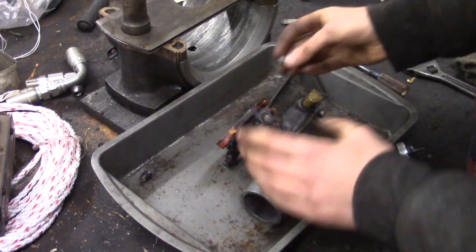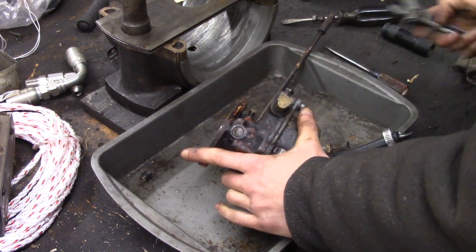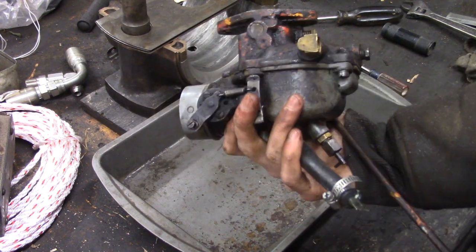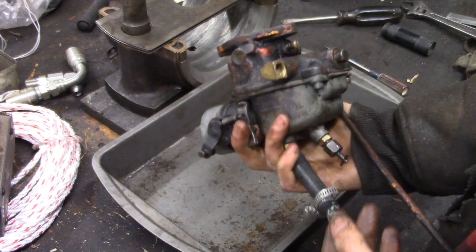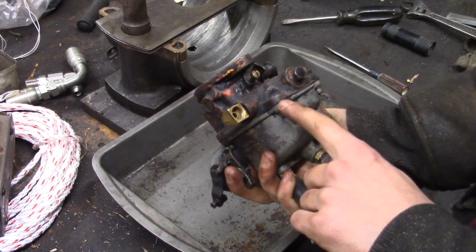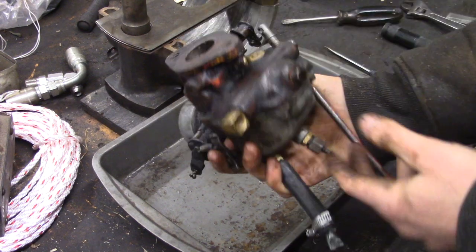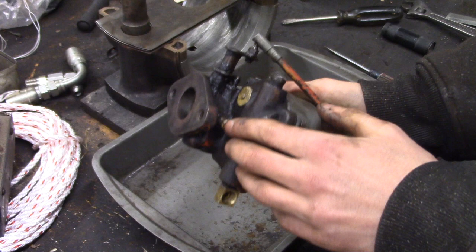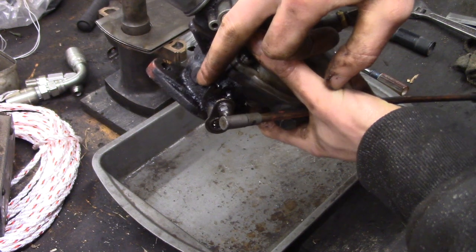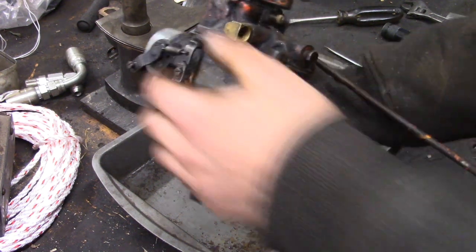That's the last of my spare parts — just these plugs for the alternate fuel inlet locations. There you have it, ladies and gentlemen. That's pretty quick and easy. You didn't need to buy anything. The carburetor kit for this was 30 bucks — really not that bad, but it was definitely 30 bucks I did not need to spend. Even if I tore that gasket, I could make one. Once this goes back on the tractor, we can dial in the full fuel, idle fuel, and also the idle speed with that stop screw there on the throttle linkage. But it'll be pretty well dialed in as it is. The tractor was running well — it ran great at the guy's house, and then ran like a bitch and stopped running when I got it to my house.